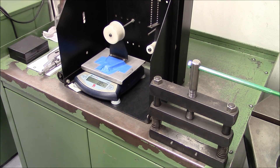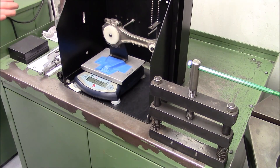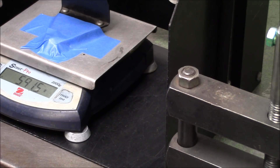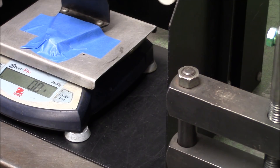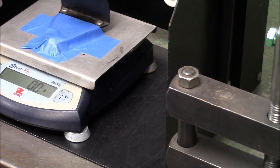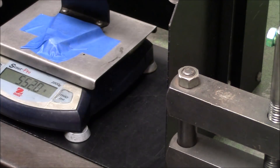We're taking out the majority of the material before we start machining because we don't want it to affect our finished machining surfaces. We've already determined that we have plenty of press on the small end. We're weighing the big end of the rod — 591.4, 591.5. We'll mark it and show a few of them here. 591.4 — put it back on the table, 591.